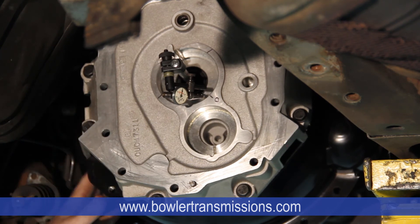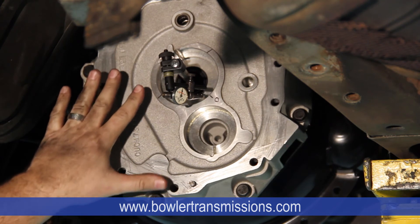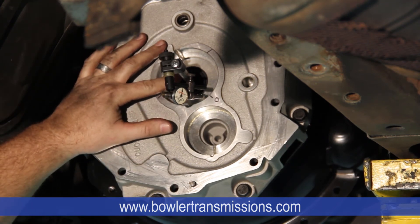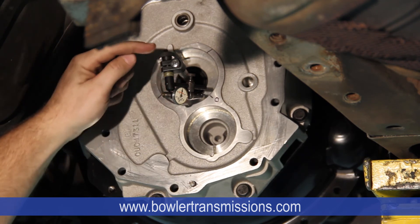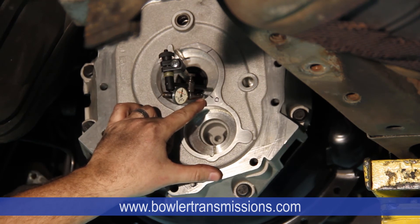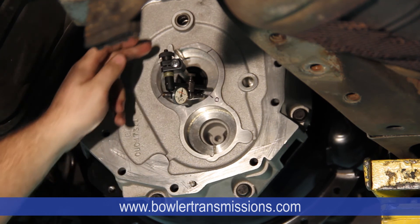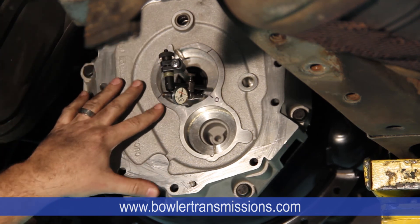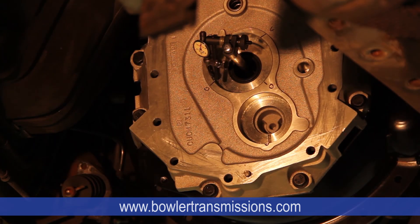As you can see, I've got the bell housing and the front cover bolted on. Go ahead and torque all your bell housing and front plate bolts down to spec so everything is just like it would be when installed. We're going to take our magnetic base and mount it onto the crankshaft flange or onto the flywheel, whichever is easiest for your setup. Then mount the dial indicator riding right on the inside of the bearing race of this front cover — I've got it marked here at zero, so that's our starting point. We'll rotate the engine around and note measurements at a couple of different locations to check total indicator runout. According to our measurements, we still fall within the spec Tremec gives us, which is within ten thousandths total indicator runout.